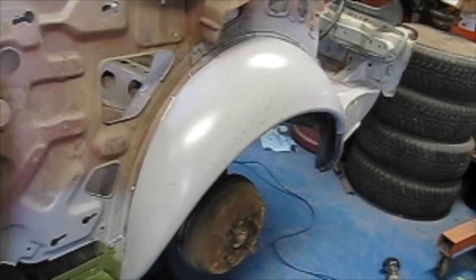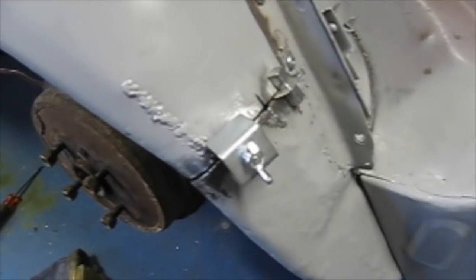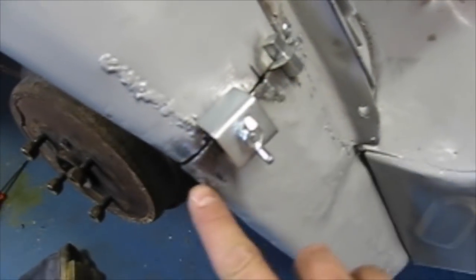The wheel tub is fitted. What I want to do is take the grinder along here, grind it, cut a slit in there as I go, pull the bad metal out, and run tacks in there. That way I get the most tight, best fit. I'm going to start with welding this portion together and then we'll work our way across.